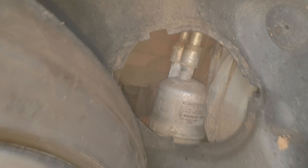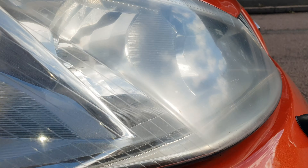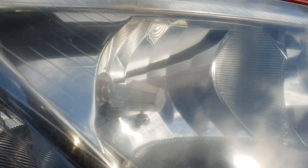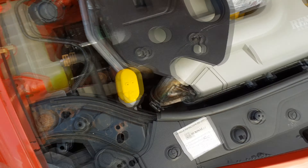For the driver's side, you need to be on full lock left and to jack the car up, but then all you need to do is remove the access cover and reach through. It's quite easy with some experience to do this blind, but if you need some visual aid to help see where the bulb is, you can remove the left engine trim quite easily and see what you're doing.